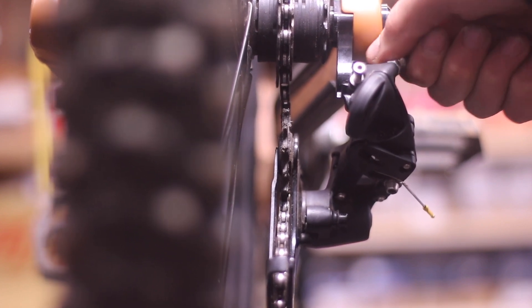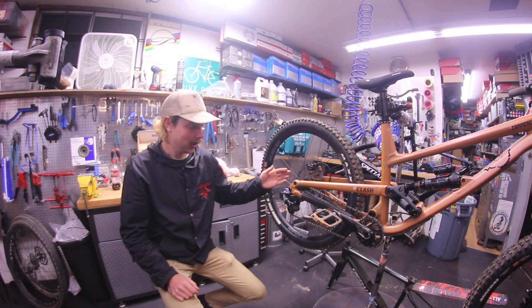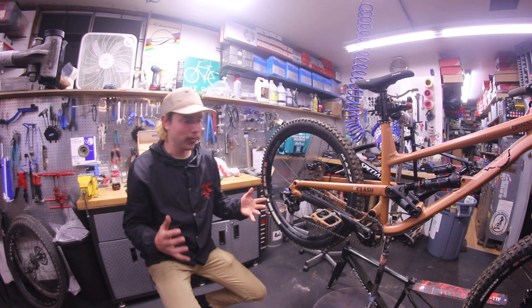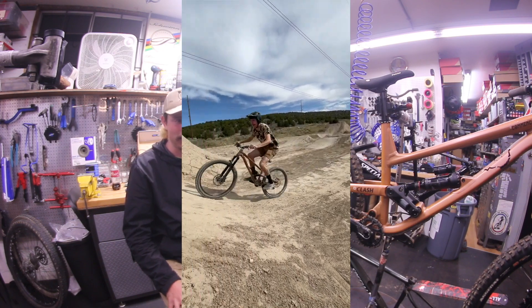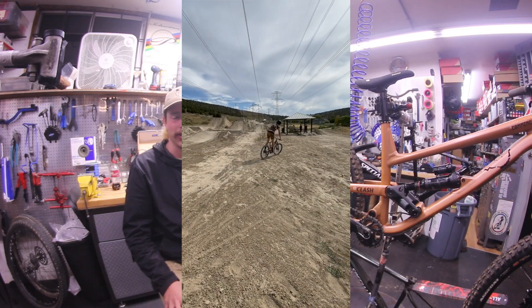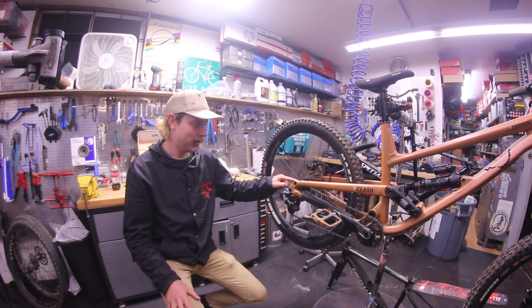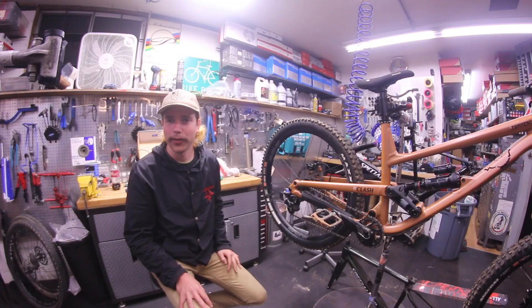You can start pedaling and you'll hear some noise from the derailleur. As you tighten or loosen this barrel adjuster, you can get it to quiet the system up. You're probably thinking this is a little bit unorthodox of a system, but I think it does work. Having ridden this on some gnarlier things, I honestly believe in it and feel completely confident when using this for freeride type stuff. If you have a better setup or a way to improve on this, let me know. And thank you for watching.